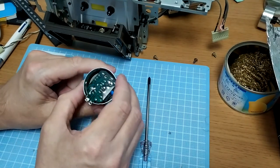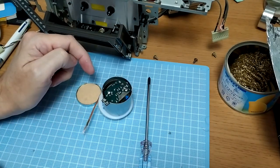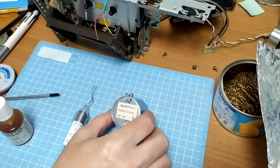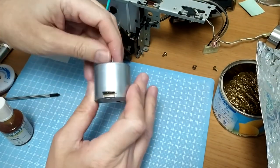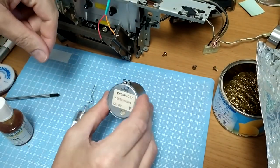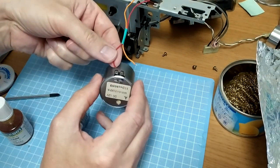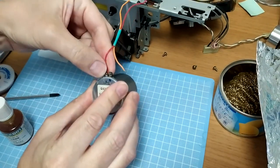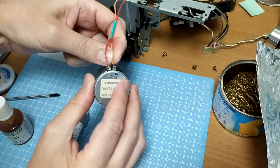The next thing is to put the base plate back on and then get to soldering it back in. I've got the bottom plate back on — just hammered it in and it's sitting nice and snug. I did test the motor once more with a nine volt and it works, seems to have enough torque. So now we'll solder these back in and put the mech unit back into the deck and throw some tapes through it.